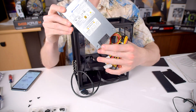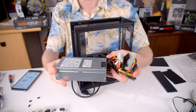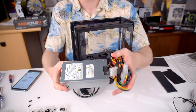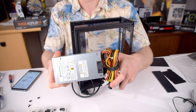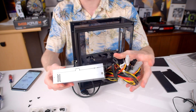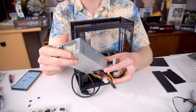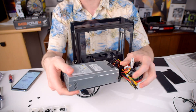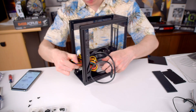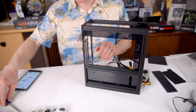After the front panel IO is in place, next you install the power supply. The one I'm using here is an FSP400-60FGGBA, which is actually targeted at server or data center use. It's a FlexATX form factor, which is what's required for cases like this. It can deliver 400 watts and it has an 80 Plus Gold rating for efficiency. It's also one of the few FlexATX power supplies that has an 8-pin PCIe connector, which you'll need if you're going to be using a higher end graphics card. It does take a little bit of effort to maneuver the power supply and cables into the case, but once it's lined up with the mounting holes in the back, getting the screws threaded is pretty straightforward.